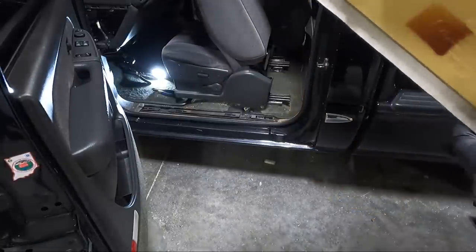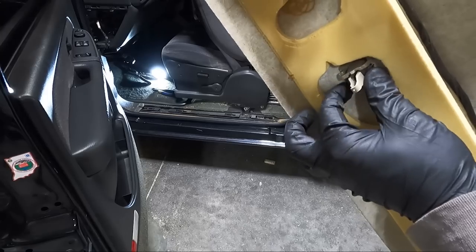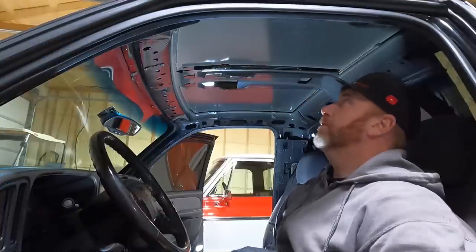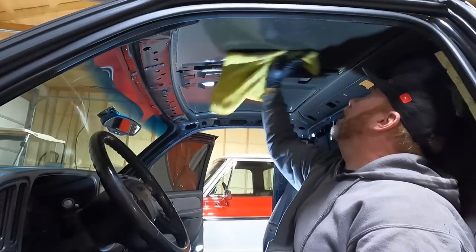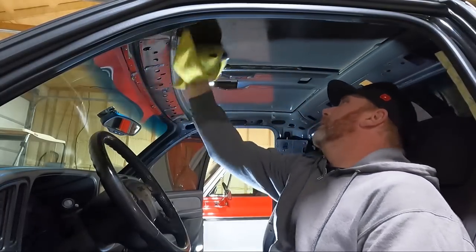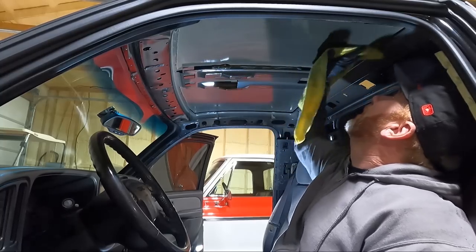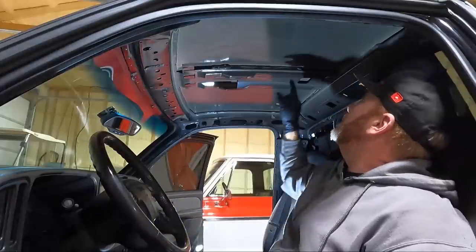You can take these off too — this is that piece I was saying you needed to pinch. It's still glued on, which is nice. These guys just kind of pinch together and push out. So I'm looking over all the dirt and stuff that makes me crazy, and I'm thinking — hey, we've got the headliner off, why don't we at least coat the roof with some sound deadener? We did it on the green truck — we did the whole truck. While I'm not planning on doing the whole truck here, I thought let's just do it while we wait on the headliner to get finished. So what I'm doing here is using some rubbing alcohol, just wiping this down so we get a good surface for stuff to stick to.